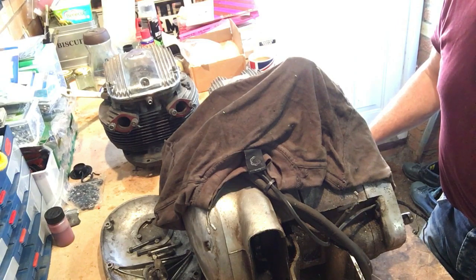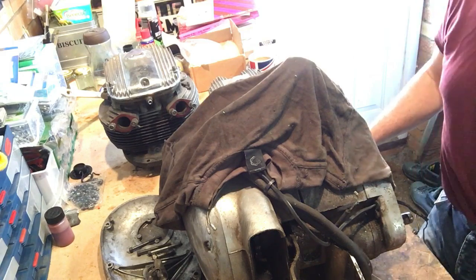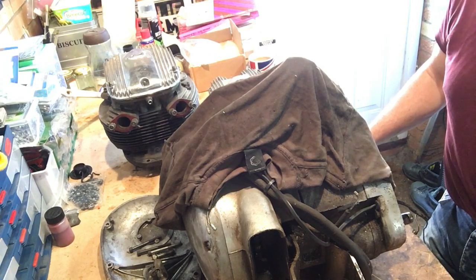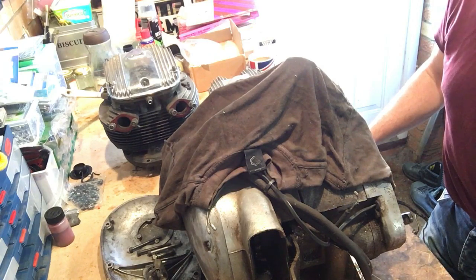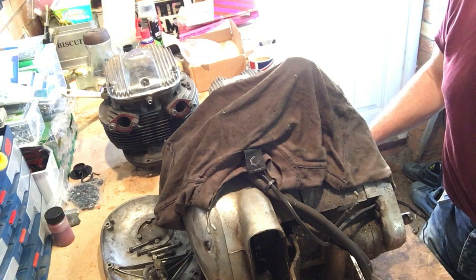was correct in that firstly the crank was present, which is all important obviously on the A70, because that's probably the major distinguishing factor and gives the 750 its capacity because of the longer stroke. So that was important. Second thing was that there was only one piston and conrod, the right hand one.